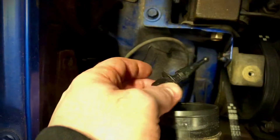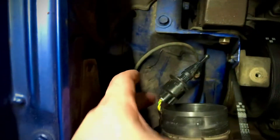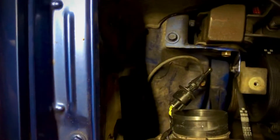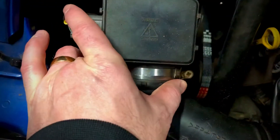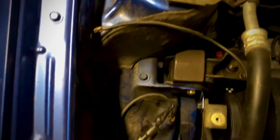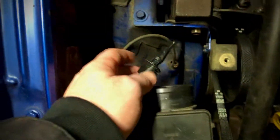So what I do is put the sensor right in the cone filter like this as I reattach everything, and just screw it into position. The heat shield goes on this side of course because the engine is here, and you can also use some zip ties to put everything in order so it doesn't move too much, or you can do some brackets and screw everything back if you use the original airbox as a frame.